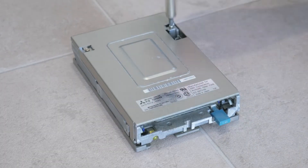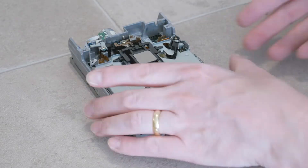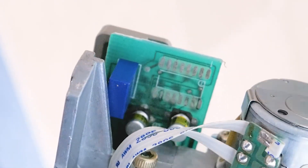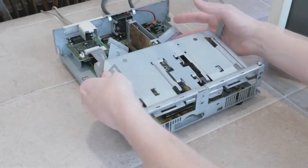Now let's inspect the inside of the floppy drive before we try giving it a workout. I took the lid off and didn't find too much dust or other debris, but there does appear to be some corrosion damage on part of the PCB. It's common in drives, and in fact all computer hardware of this age, to have electrolytic capacitors that fail and sometimes leak onto the board to corrode traces, as appears to be the case in this drive. We'll probably need to do something about that to clean it up and maybe repair it.